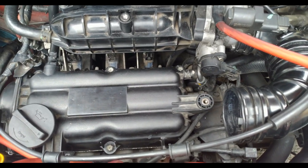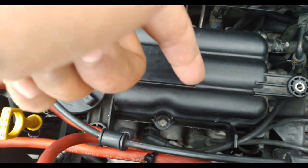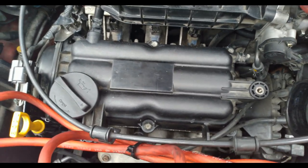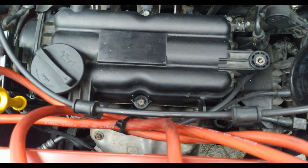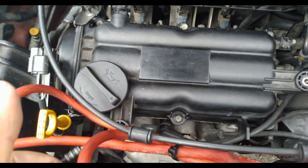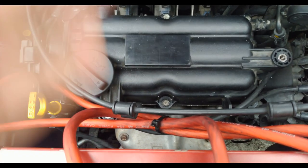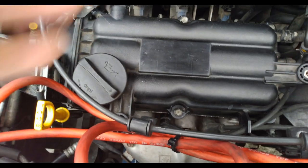Compare the vibration from earlier to now. So if you're having a misfire — even if everything is plugged in — the vibration is too much, the idle is erratic, and you have black smoke from your muffler. If you test the continuity of the ignition system and it's fine, then the next thing to check would be the spark plug, because the spark plug might have fouled out or needs to be replaced. Even if the coil throws power to the spark plug, if the electrode is fouled out, it will not produce any spark for the combustion chamber.